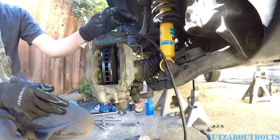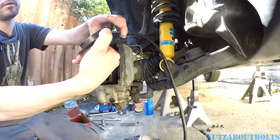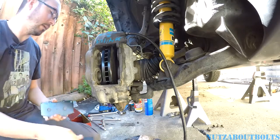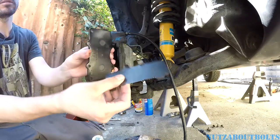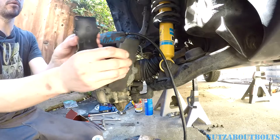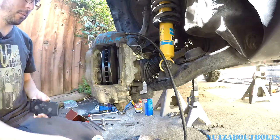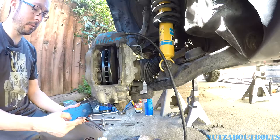Back to work — we've got to still put in some brake pads and lubricate some stuff. Here are the brake pads — putting the one with the little feeler thing on the inside, so the brake pad makes noise when it gets too low. It does come with shims — some of these are sometimes glued on, but this is more similar to original equipment, a shim that just clips on. Between the shim and the pad or backing plate, you should put some brake lube in there, which will help get rid of the squeaks.